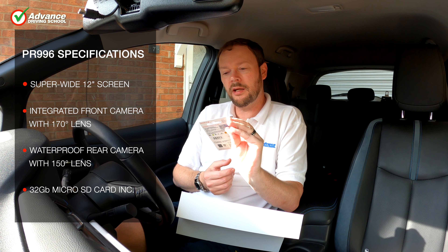It comes with the same rear camera as before and all the cables. It's just a question of whether you want to have the external front camera or have it built into the mirror. In terms of recording quality, you can have it set at 1080p full HD at 30 frames per second, or if you want to economise on memory card usage, you can knock it back to 720p at 25 frames per second. They also have a parking mode to monitor the car whilst you're away, and there are optional reversing guidelines to help when you select reverse.